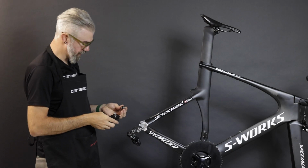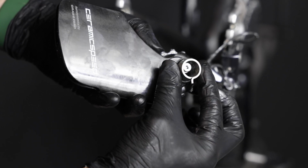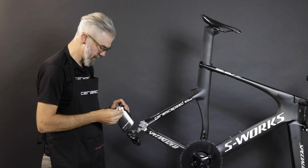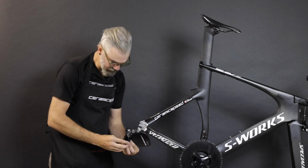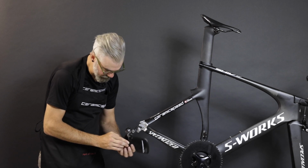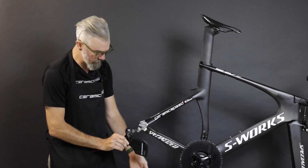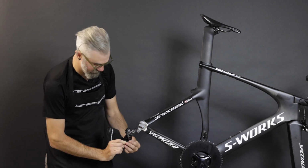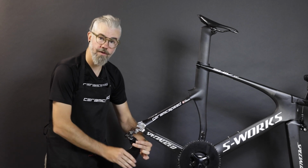We'll now line up the spring onto the derailleur, going from the second from lowest spring tension setting. And then with the dust cover and the spring ready to go, we will align these, bringing the derailleur back, pointing the spring up in the derailleur body, and then bring everything together easily. When your spring and dust cover line up properly, there'll be no gap, and then we can bring this back over the ramped stop tower and into place here, having a nice lateral fitment and still clear motion.